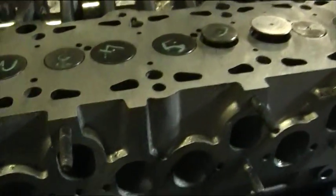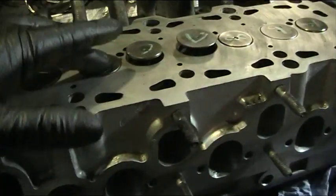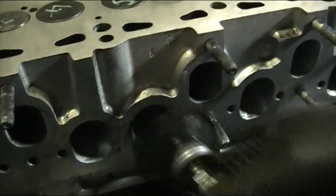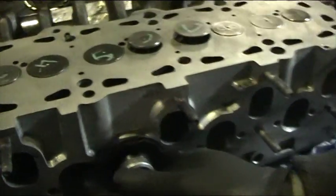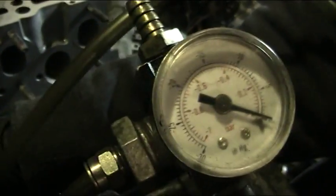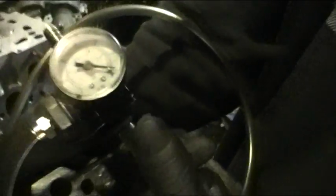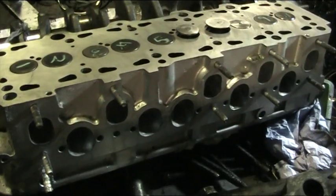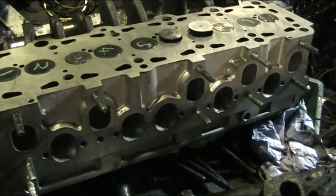This is a cylinder that we've been reworking. We've got all the seating area correct and the valve seats correct. T's just about to put this on, and as you can see, that's gone up to around about 25. Anything after 15 is a pass, but we like to get these up to 25.